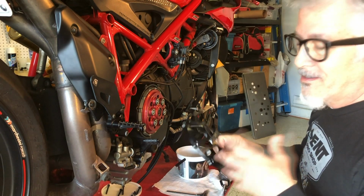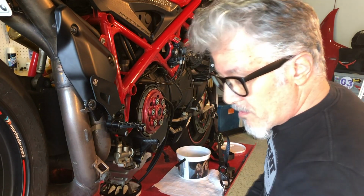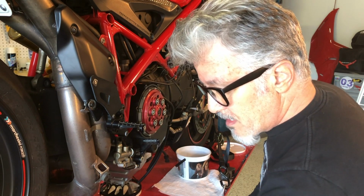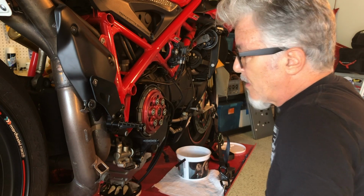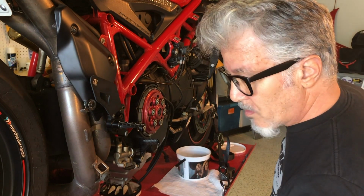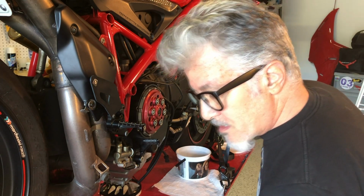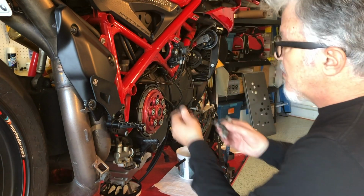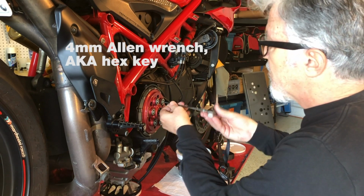And I put it back together, so it's gonna come apart pretty easily for anybody who hasn't done it before or needs another place to find a video. There's one tricky part which I will get to, and I'll show you how that's done. In the meantime, let's start with loosening these guys here. Use your 4mm Allen.